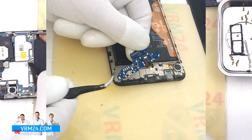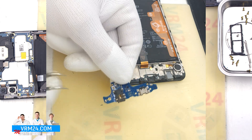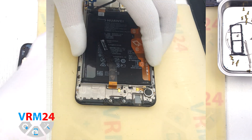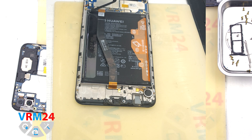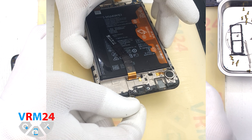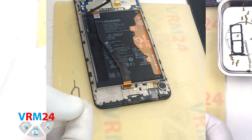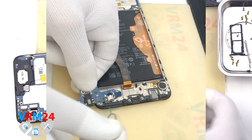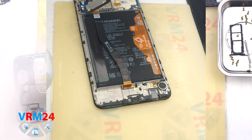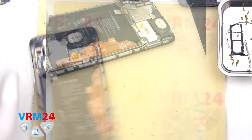The subboard contains the microphone, charging port, headset port and other elements on the back side. Now a quick test of the microphone hole: the microphone hole has an L-shape and is located perpendicular to the microphone on the subboard. If we insert anything into the microphone hole we can't damage the microphone this way. Note that the microphone hole is protected by a membrane in the display frame.